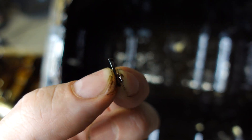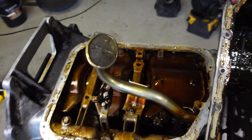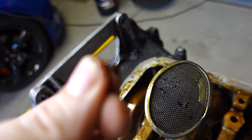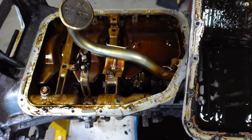Let's see what we got in the oil pan — a little bit of aluminum right there. This could be from the timing chain or maybe that valve cover grommet that I broke. We got a little bit of what looks like silicone or something in there, but that's about it. Pretty clean in the oil pan. I did flip the motor over so debris could have fallen in there. As far as the upper oil pan, we got a little bit of debris in the strainer — looks like silicone or something. This looks like a twig. This might be hardened plastic from the timing chain guide, but pretty clean. Now we've got to get the upper oil pan off.